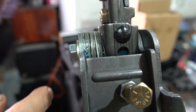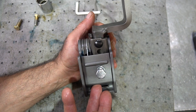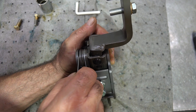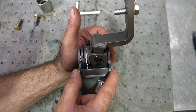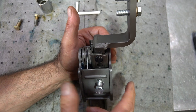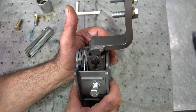If this gate has too much slop, the selective plunger will come out between both gates and jam up the shifter. Here's the 8010 assembly all done — you can see the gap is a lot less than it was at the start. Taking a feeler gauge, it measures right around 50 thousandths uncompressed. When you compress it, these will go down to around 25 thousandths — you lose around 20 to 25 thousandths when compressed. Uncompressed should be around 50 to 55 thousandths, which is the standard for older shifters. The new shifters out of the box were 80 thousandths uncompressed and 50 thousandths compressed — way out of spec.